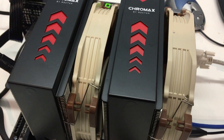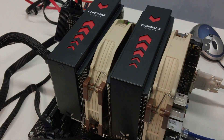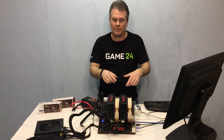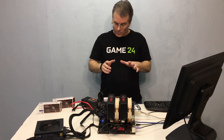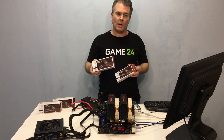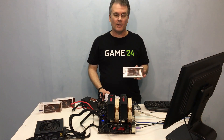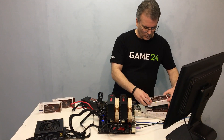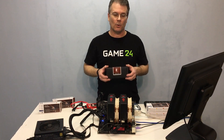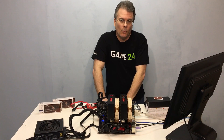Here's a quick teaser on the next review, which will be on some of the Chromax line of accessories from Noctua — so if you want to dress up your cooler, stay tuned for that review. The testing here tried to keep all variables the same: same cooler, same fan, same fan speed, same room temperature. The only real variable is how you apply the paste, and I try to do that as consistently as possible. It looks like the NTH2 thermal paste can keep your system a couple degrees cooler. If that's important to you, the extra expense for the NTH2 might be worth it. Otherwise, the NTH1 is well proven over the years to be a wonderful thermal paste. We also have the NASCW1 wipes for cleaning your system whether you're doing a fresh install or have an older system five, six, seven years old and want to put some new thermal paste on there. This is Chris with Overclockers Club — thanks for watching and don't forget to subscribe.